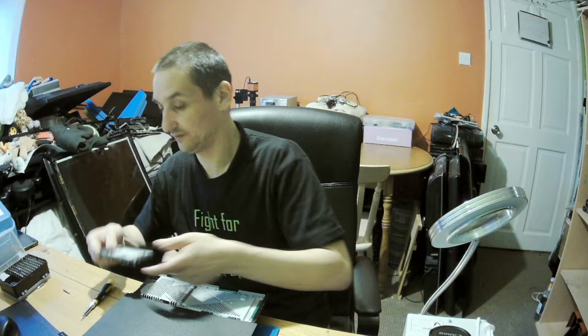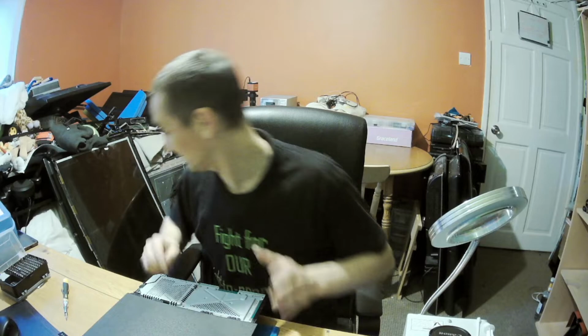And that's a Blu-ray, so let's get it this side, and let's put the hard drive as well. Okay, let's put the hard drive before doing anything stupid. Which way? Okay, the shorter connector, which is the power connector, and the SATA connector goes closer to the outside world here. And now we need a cable. Okay, power cable.